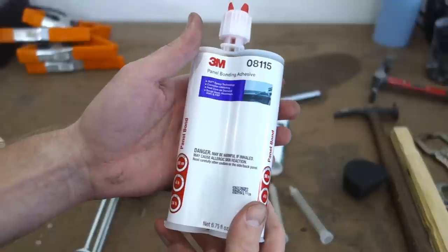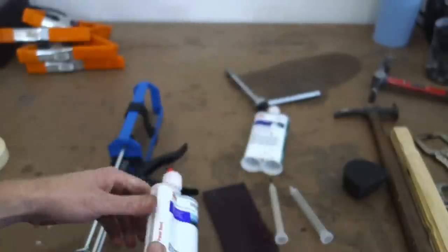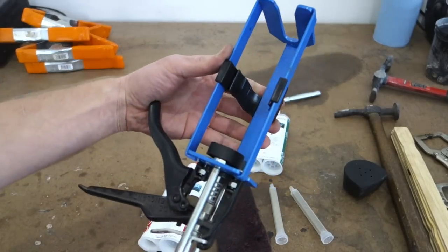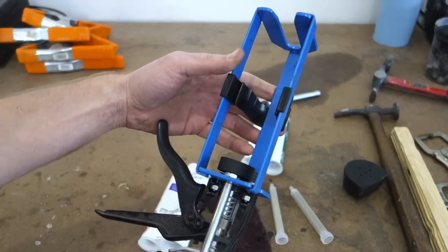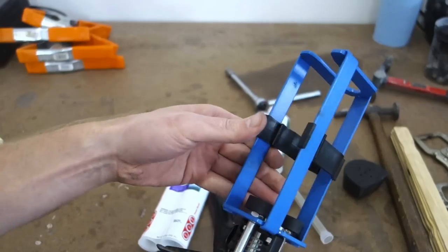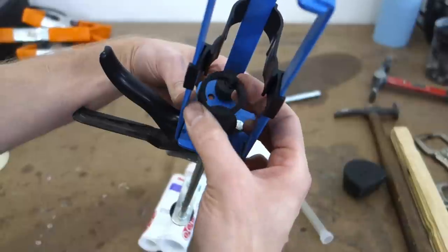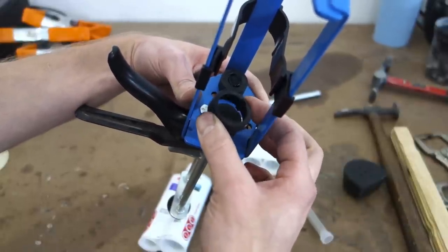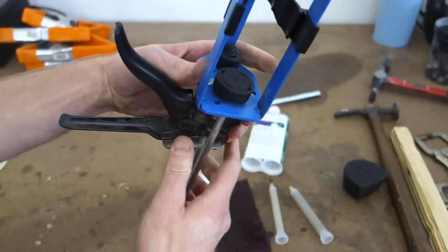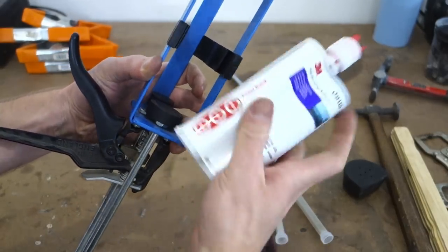All right guys, so we're going to start off with the panel bonding adhesive, and this requires a special gun. So here is an off-brand gun that I got on Amazon. Link will be in the description. There's also a 3M gun which costs twice as much, but basically, you can see these come with different size plungers, and it comes with different rings that you can attach on there to make them wider. So what you want to do is make sure that you find the size that fits as close as you can in these.